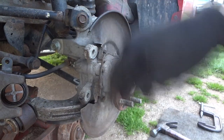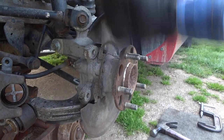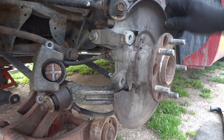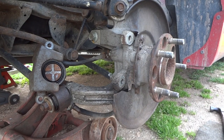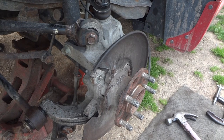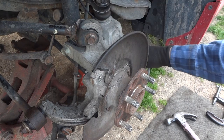Now we're going to go ahead and get this wheel bearing out. There are some bolts behind here and it should pull off. I was worried I'd have to pull this whole assembly off and press it out, but I believe there are four bolts back here and the whole thing will come off. I went to loosen up all the little bolts on this plate - forget it, don't even waste your time because the hub has to be pressed off. So I'm removing these 14mm bolts from the back - there are four of them.